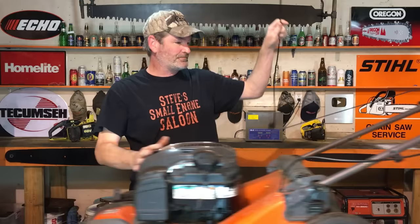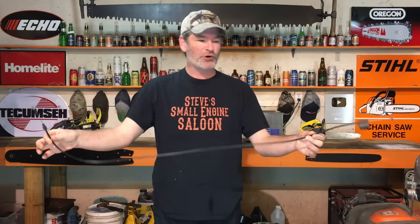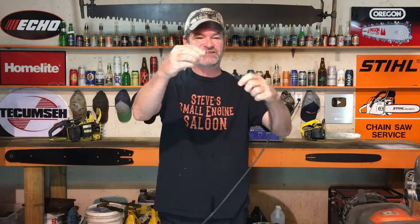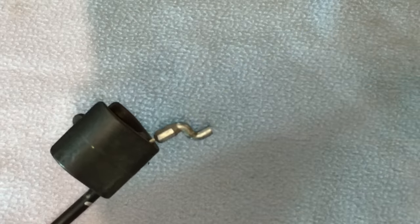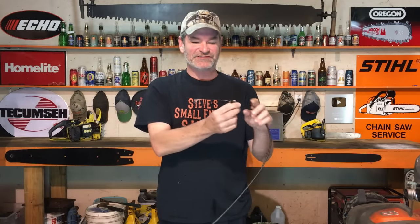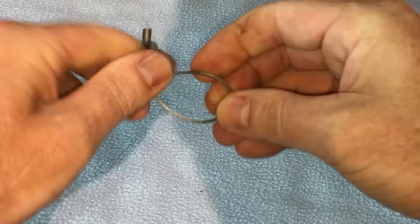I got that cable off now. You can see your typical lawnmower cable — this even applies to drive cables too, if your drive cable is not pulling far enough. There are two parts to this cable: there's the inside part, the steel cable, that slides in and out through the outside part, which is pretty much just a plastic sleeve.